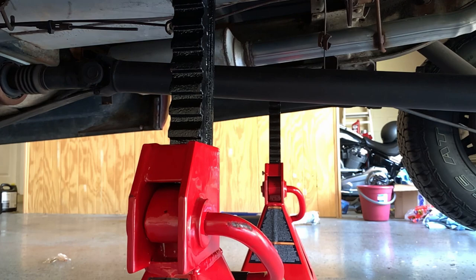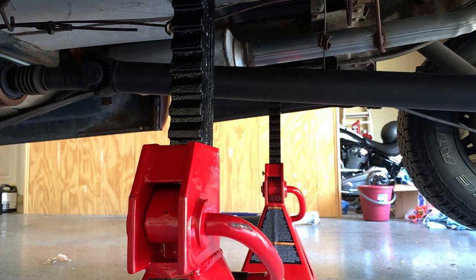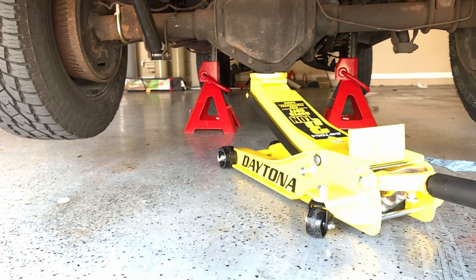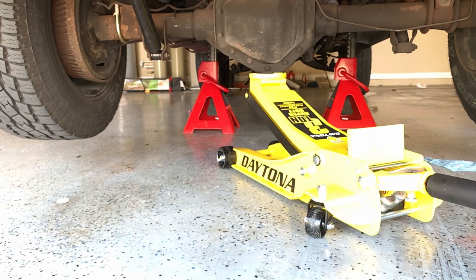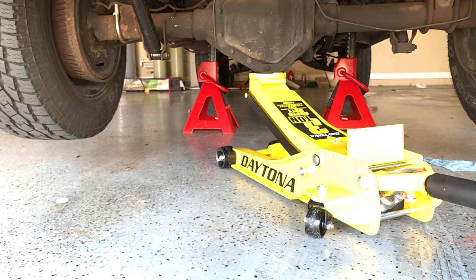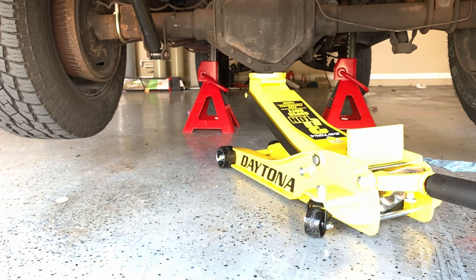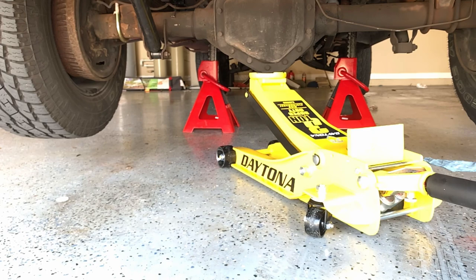In this case you could use things like the mufflers or special clips and fasteners for things like the parking brake to easily align without too much effort. Once your jack stands are set you can go ahead slowly and carefully — preferably with spotters — lower the rear differential so that you can begin ensuring the frame seats perfectly onto the jack stands. Once you see that it has caught the jack stands, double check your work and ensure the rear differential will lower far enough to keep the tire from touching the floor.